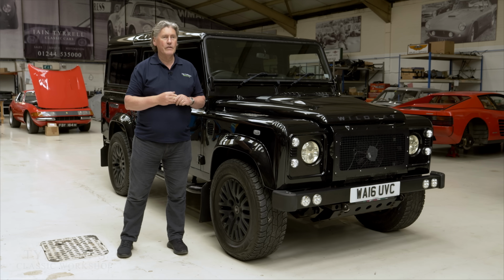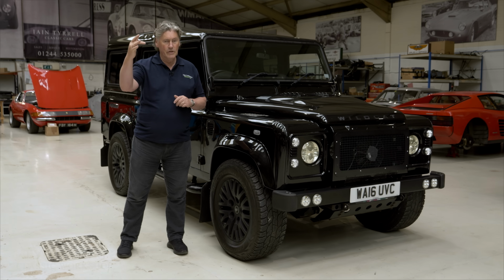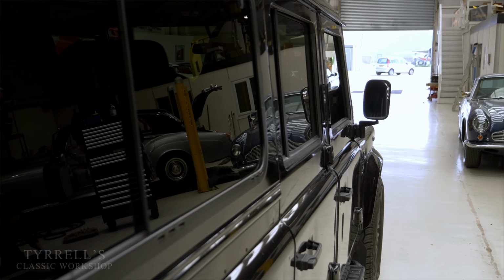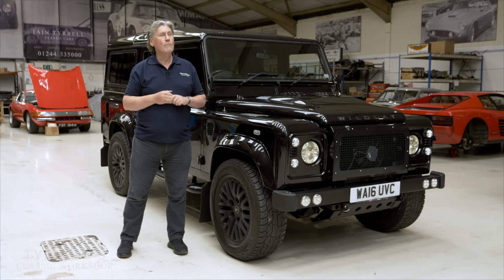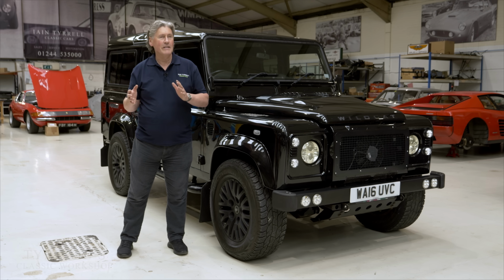It worked very well, but Rolls-Royce went for a different solution, which was a tiny little lever, and you just literally fingertip, and the electric motor on the side of the transmission casing, GM 400 mostly, did the rest. I've never had to do any work on an electric motor in 40 years of working on Rolls-Royce and Bentley. I've never had to fix an electric transmission selector motor or the mechanism. Marvellous bit of kit. Anyway, I digress.